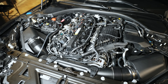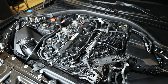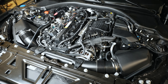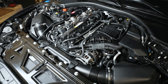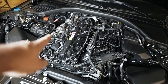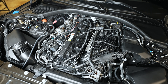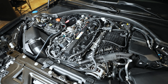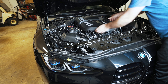The only reason I have a little bit of knowledge on this is because back in the day I made my E30 run on a standalone engine management — I had to figure everything out from scratch, solder the ECU, and do everything myself. So is the S58 a technical masterpiece that looks completely different than any other turbocharged inline engine? No. The only thing that catches my eye is seeing two fuel pumps instead of one. You really don't need two fuel pumps to make 500 horsepower, but you can make 750 crank without going nuts on fueling upgrades — that's the reason.